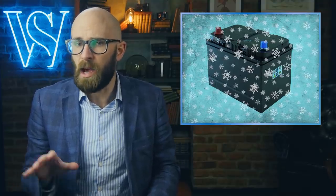On top of that, the problem is potentially made worse by the fact that an extremely cold engine may, in some cases, take more cranking amps than normal to turn over, all potentially contributing to people thinking cold weather is worse for the battery than hot. For reference, according to Industrial Battery Products, a typical lead-acid car battery will see about a 50% drop in its normal cranking amps at -22°F versus around 75°F. On the flip side, that same battery would see about a 12% increase in cranking amps at 122°F versus 75°F.